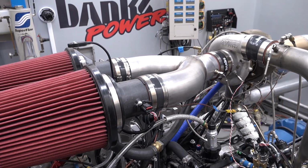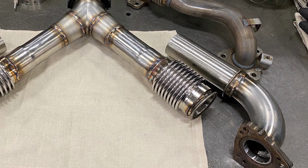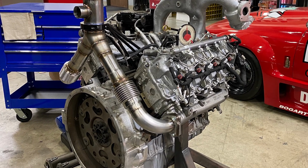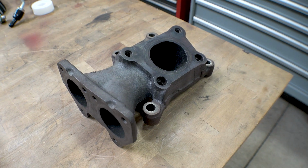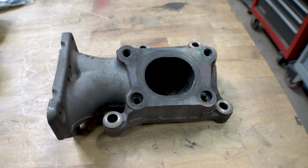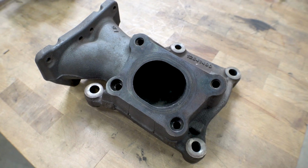To get the turbo up, we got rid of the aftermarket up pipes and fabricated our own 2 1/4 inch pipes with very gentle bends up into a 3-inch forged collector. In the process, we eliminated the stock turbo mounting foot. It's fine for the stock turbo, but we're doubling the horsepower, so the stock foot has become a major choke point.